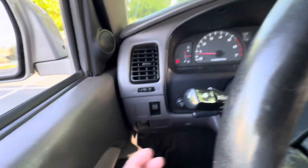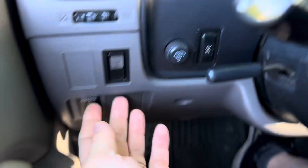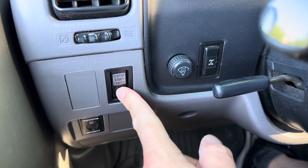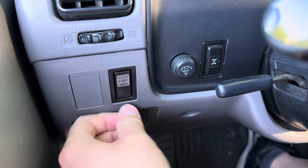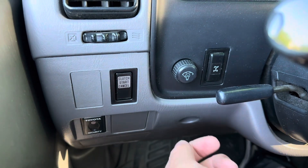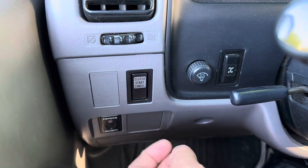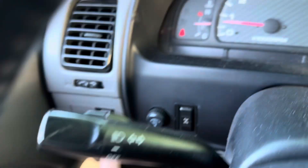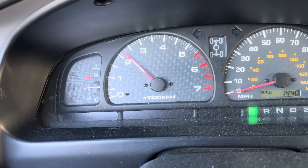It is way more responsive compared to the stock ECU. Just for fun, I hooked up launch control. As you can tell, this is an automatic and I just found a clutch start cancel switch because it fits here and aesthetically looks decent instead of just a big red button. I've got launch control set up at like 3,500 RPM.